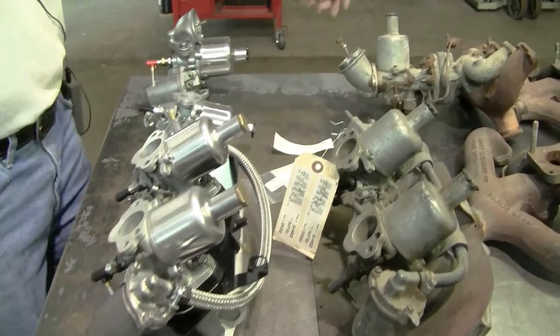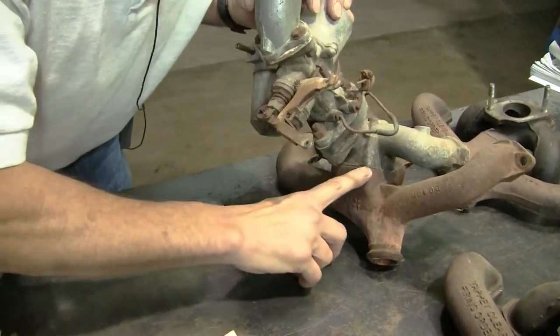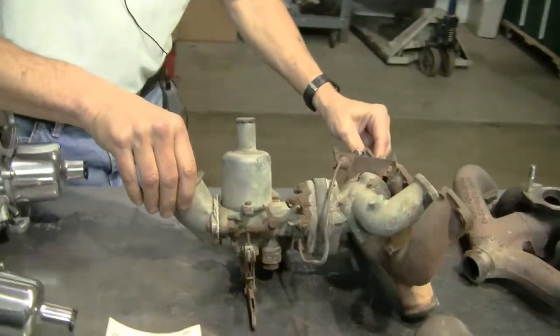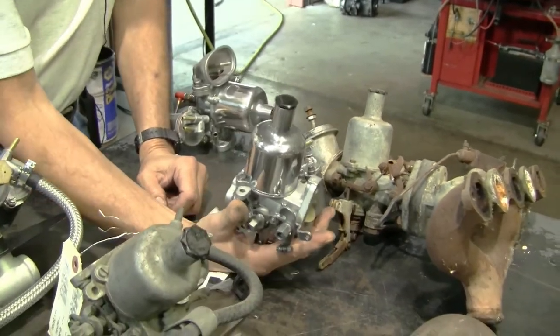Here's an old antique one — it looks like a one-piece manifold but it's actually a two-piece with a bolt on it. This is an H carburetor — you can tell by the bowl, which has a single bolt on it. It can be rebuilt, but you can also convert this H style to a more modern HS-2 style; the linkage would be a little different but it can be done. That's about it for the carb shop. Hopefully this helps you identify your SU carburetors — HIF 38, HIF 44, HS-4, HS-2, singles and duals. If you have any questions, call us toll-free at 800-946-2642, or look on our website for carburetor kits and replacement carburetors.